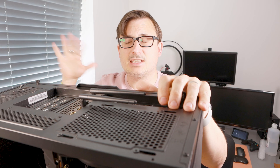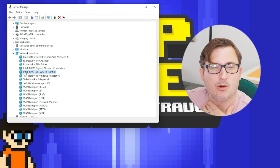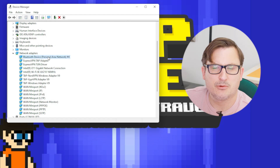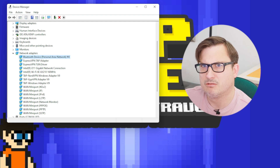So I guess I need to go back to the desk, plug in the computer and we'll talk from there. The computer's back, plugged in and working — that is a good sign. I don't know if the wireless card has got drivers automatically installed, so what we need to do is go to Device Manager. If you don't know how to get there, just click on your Start button and search for Device Manager. Let's have a little look — Network Adapters. We've got a Wi-Fi adapter there. Check the properties — it's all working fine. And we've also got a Bluetooth device, and the Bluetooth icon has turned up in the bottom of my Windows taskbar. That's really good.